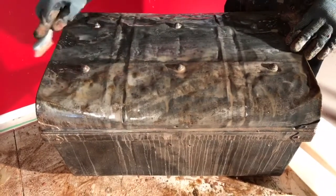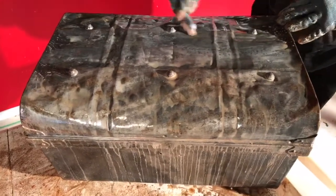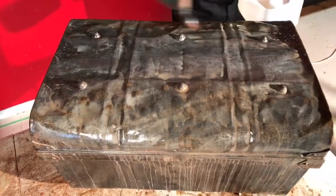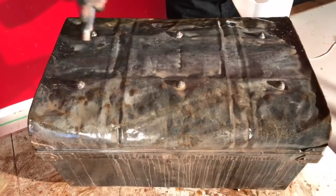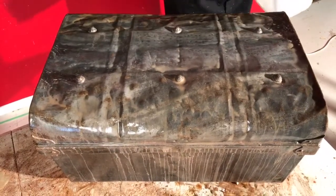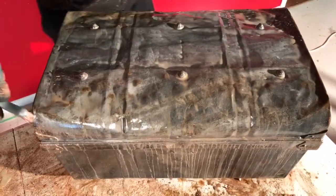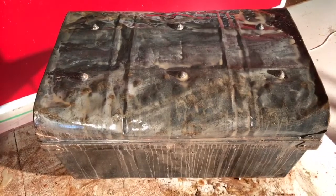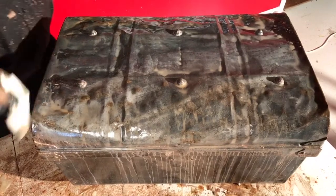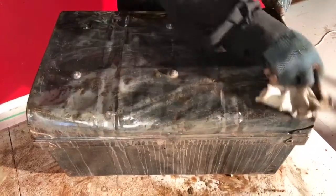Okay. So this is killing the corrosion in exactly the same way as phosphoric acid would. It's not saying it's gonna, it's like a weed killer, it doesn't mean the weeds aren't gonna come back. So you've left that on for longer, you've given it some good time to do its thing, but for today, what we're going to do is just wipe that away. We're going to then give it a rinse.